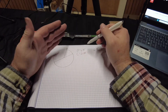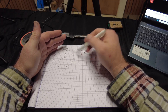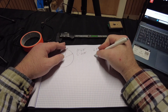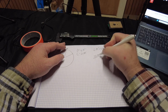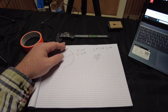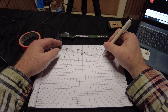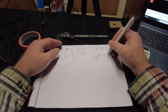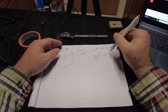So we got two valuable bits of information: we got the diameter and the circumference. Now we know the circle is 360 degrees, so we need to take that circumference number and divide it by 360 degrees. Now we know that every single degree in this circle has a distance value of 0.058875 inches. So every one degree is that distance.